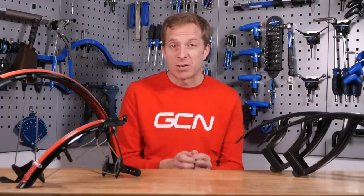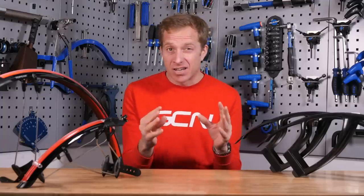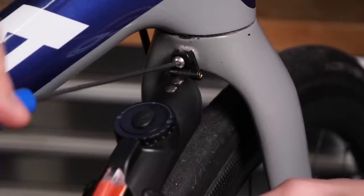Mudguards designed for really close clearance road race bikes without specific mounts generally require a bit of a compromise when it comes to fitting around the brake calipers, as this is a particularly troublesome area when trying to fit a mudguard between the tire, the brake bridge and the caliper. So whilst something may say full mudguard, be aware that your brake calipers may get a bit of grime on them as the mudguards tend to attach on either side of the caliper. Disc brake users are likely to have pretty plain sailing unless your tires are very close to your stays or the fork crown.